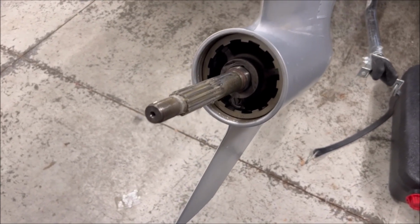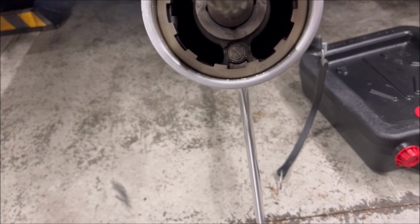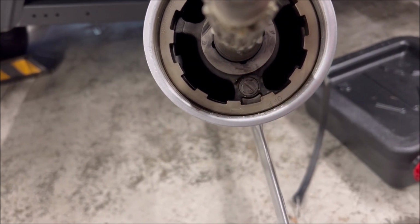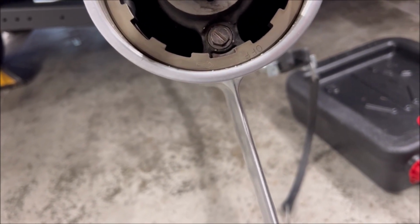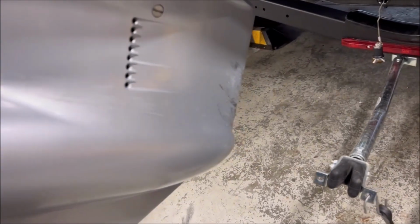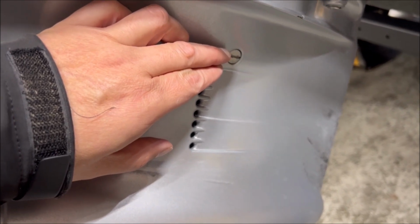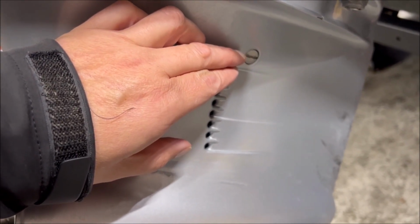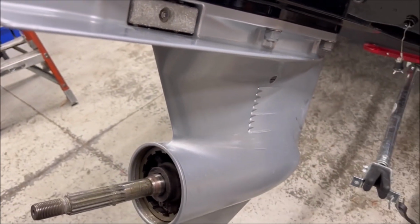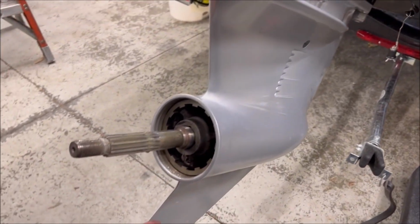While I still have this up, I'm going to show you how this works. I've got a good camera angle, and then I'll take it back down and show you how it actually works here. But this is your drain here. There's a flathead point here you can loosen that with, or a 10 millimeter socket right down in there. We're going to want to do that one first. And then there is a vent that's right here. You'll need a flathead for that, but it's kind of like the soda pop straw, right? If you take your straw and you hold the top end, you can bring the pop up into the straw. We're doing kind of the same thing here. We're going to open that up, get everything in position, and then we'll undo the vent here and it'll just start to flow out.